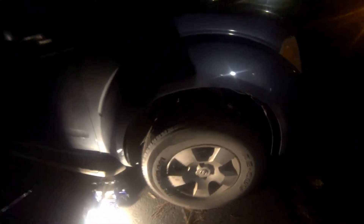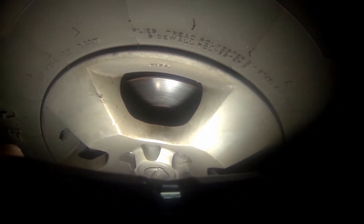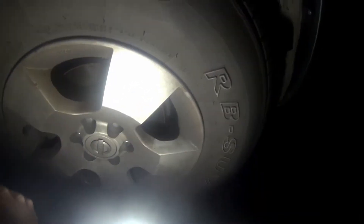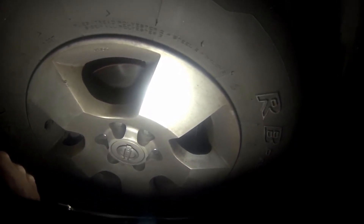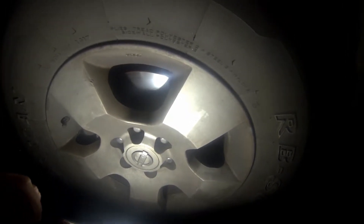Alright guys, I have a 2005 Pathfinder here and there's a lot of noise coming from this brake. I personally think there is a very deep groove that's been scarred into the rotor on the back. I've got a very strong scraping sound like it's digging into metal. I don't think it's a wheel bearing because it goes away at times, and a wheel bearing will be permanent. So I think I've got a set of pads and rotors here today for this Pathfinder.